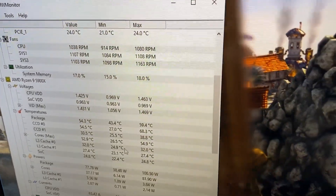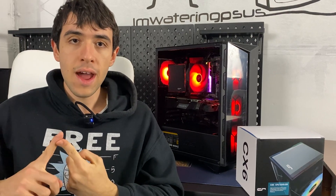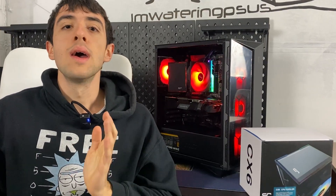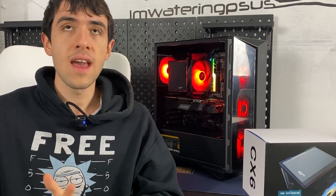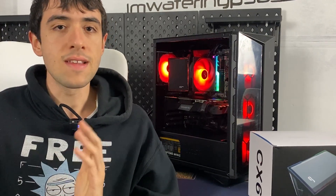What about gaming? Surprisingly, even with the GPU putting out heat, we still managed to keep the CPU under 70 degrees in gaming scenarios. This is probably the most crucial point of this review: your main issue with air cooling is the extra heat inside the case, because the air cooler puts heat inside the case whereas a water cooler outputs it out into the room. So consider: do you have a really power-hungry GPU like a 3090 or 2080 Ti? If so, you want really good case airflow or a water cooler. But if you have a lower-power card — like an RTX 2070, 3060, 4060, or even up to a 4070 Ti, or AMD cards like the 6700 XT or 6750 XT — air cooling would be fine.